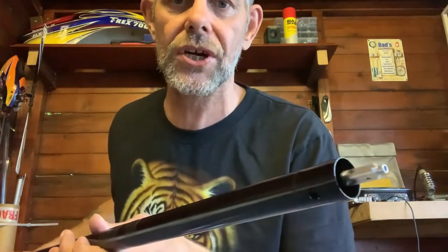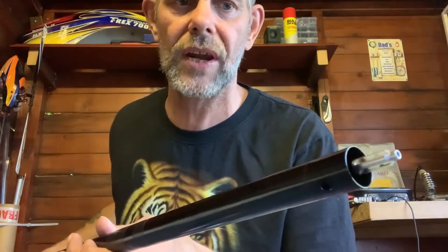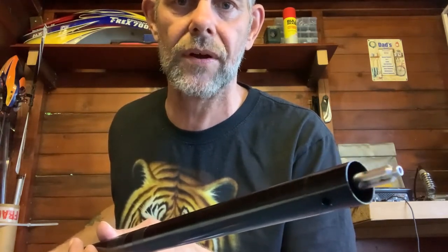We're going to stay with the aluminium torque tube. There's no point going to the expense of a carbon one. I've got one here, one I prepared earlier, which works perfectly. Let's do that test on it that we did earlier on. I turn the torque rod and you can see there is no movement on that. If I let go, it doesn't roll down.